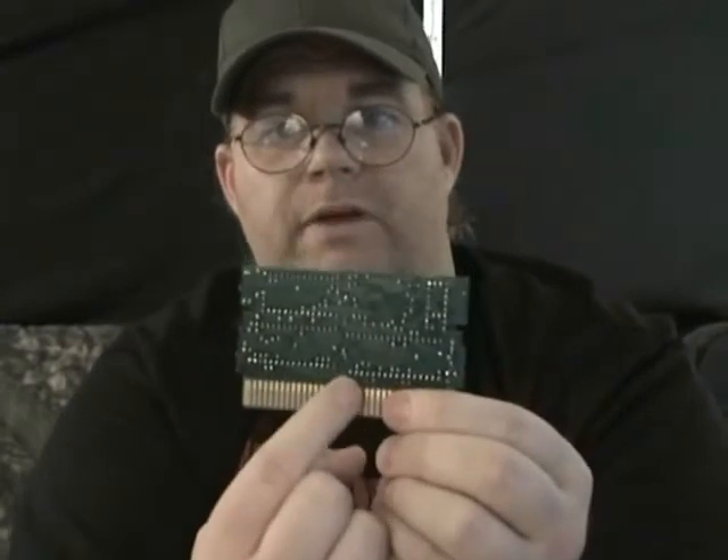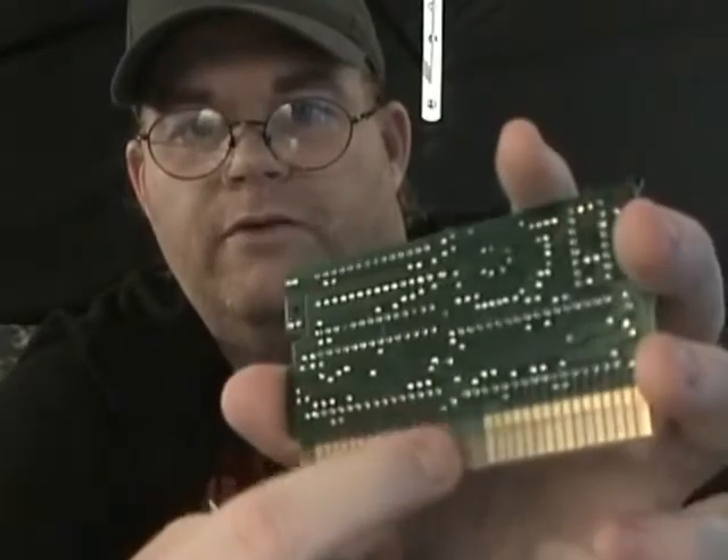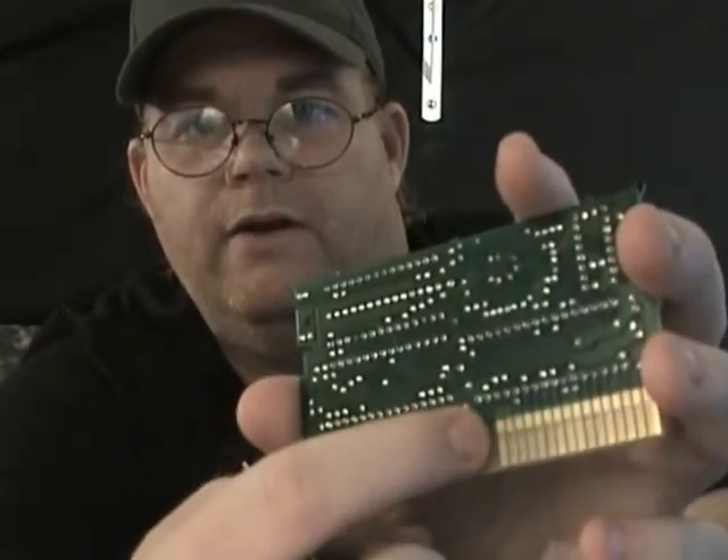Just every step is a pain. When you take these out, you have to bend up the pins and wire them all a certain way. The reason why you need all the pins is on the back, around here in the middle — pin 56. You have to put a wire over it or around it and solder it directly to the pin. On the old motherboards, that would be right about here, where this little empty spot is. That's why you need this board.